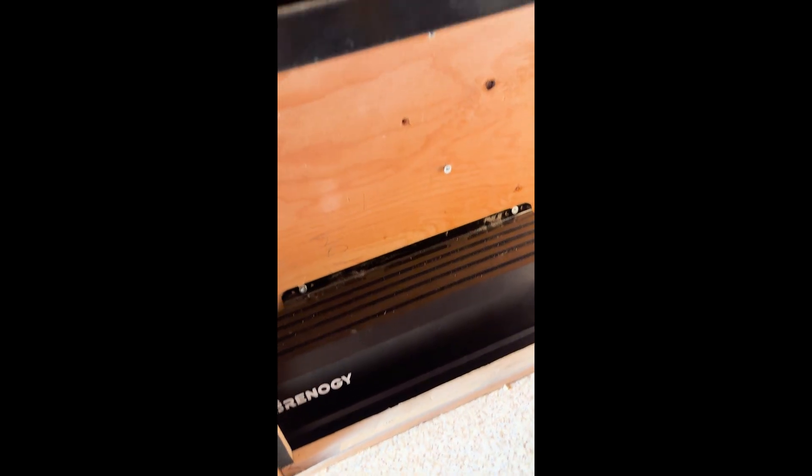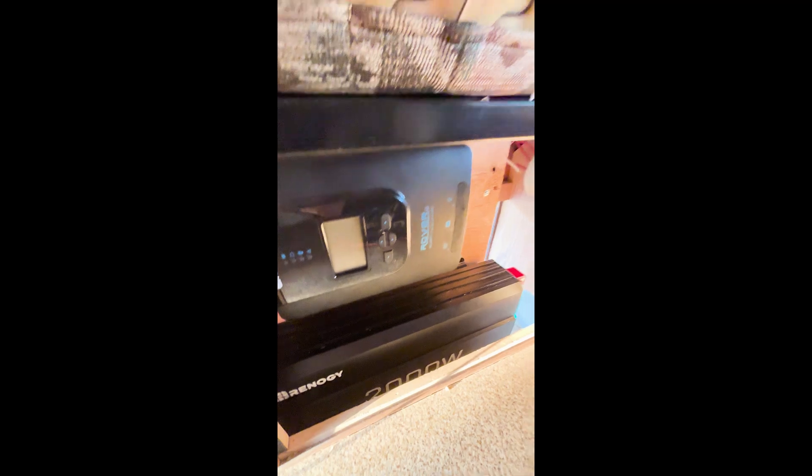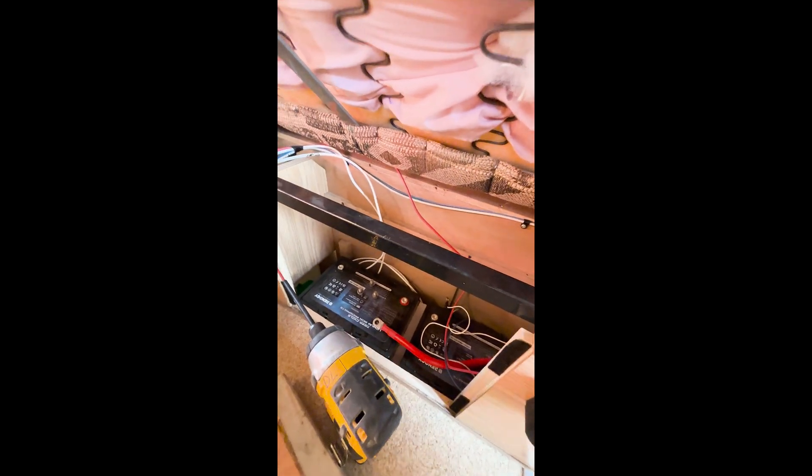We're making some progress in the camper here. I've got my inverter tucked in there, nice and low. I had to build a bit of a false wall to separate it from my water pump and give me something solid to mount on. Solar controller mounted in above my inverter, nice and tight in here. Now I can just run the monitors and the switches and get everything over to my batteries.